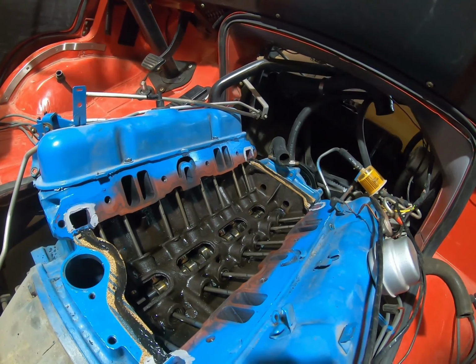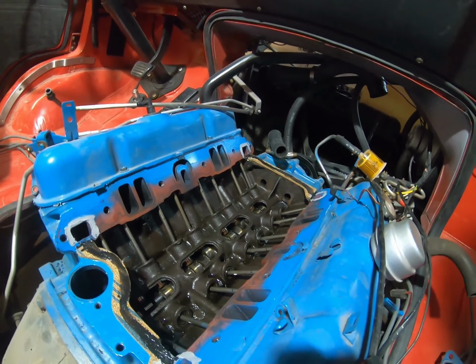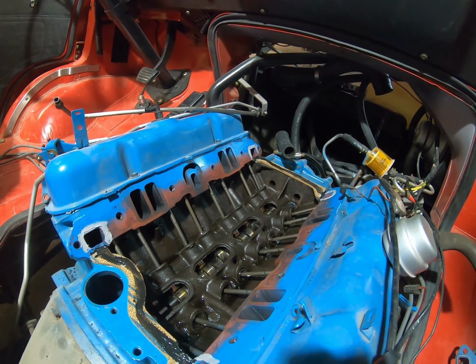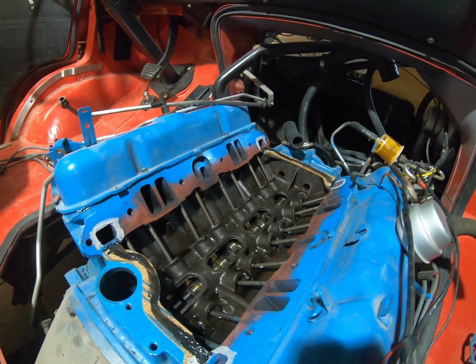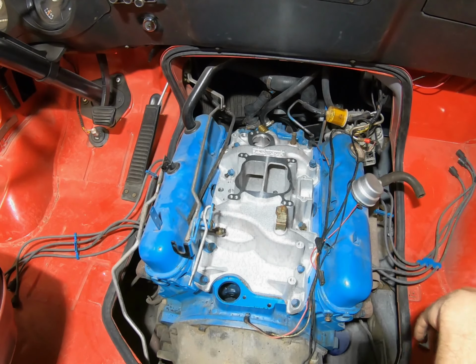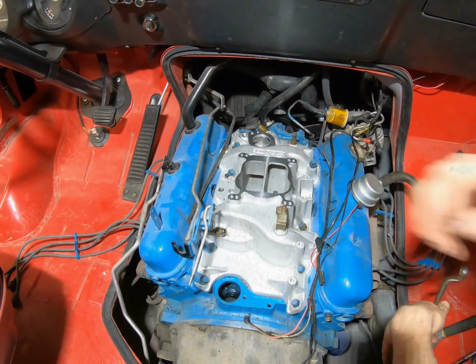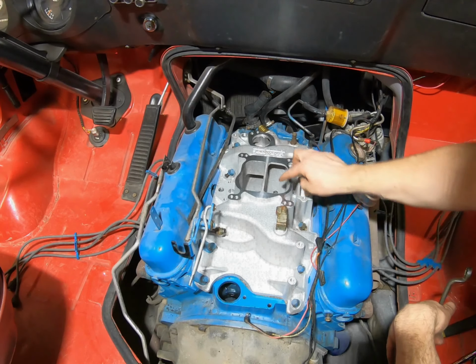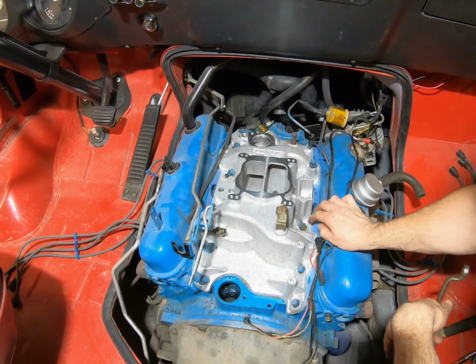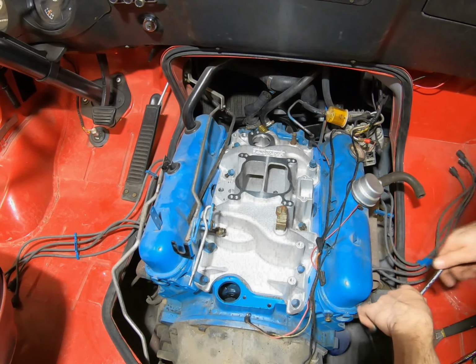So make sure you have all your ducks in a row before you go holding it all down. So we saved it just in time. Been a while since I've done one. All right, so I'm getting the bolts in here. These four in the middle are always a pain, especially over here, since the spread bore pattern and the choke stove opening kind of makes it a tight fit.